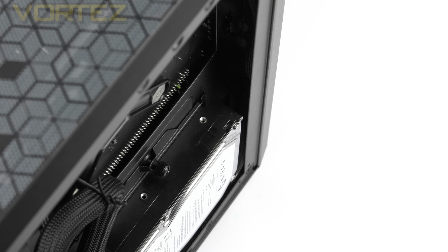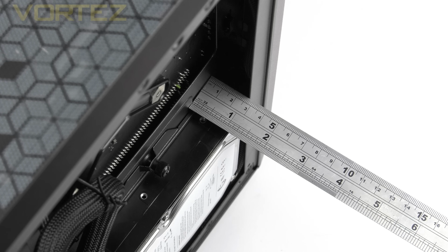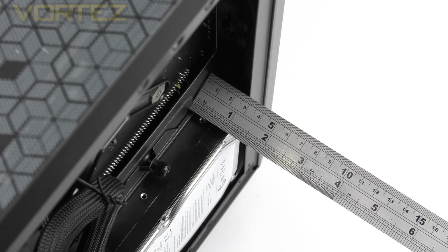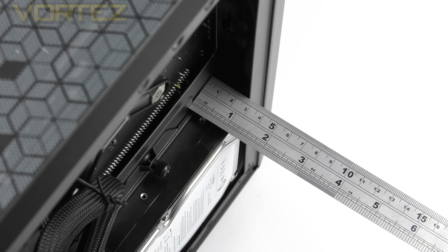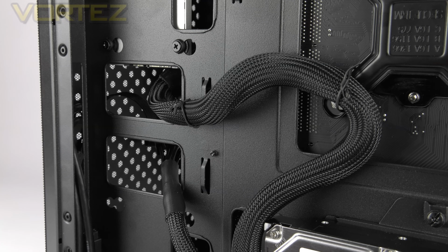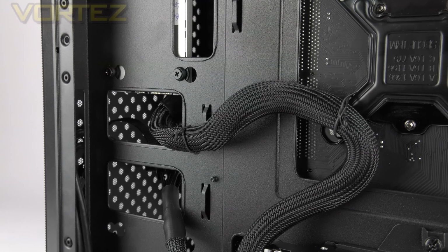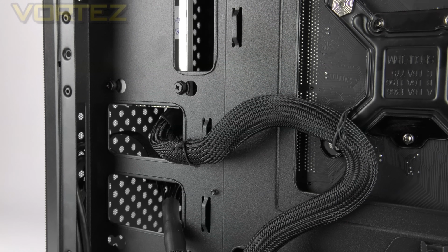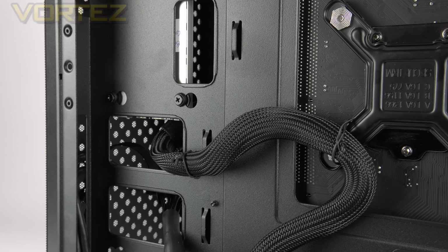Cooler Master have been generous in allowing a 2.5cm gap between the motherboard tray and side panel, clearly in part to make room for a mechanical hard drive. This greatly eases the challenge of cable management, both in terms of routing and tucking away excess. The rear of the motherboard tray also has about 10 standoffs for cable ties, making organised routing of cables very simple. Hiding cables, today perhaps the primary purpose of cable management, should be almost trivial in this chassis.